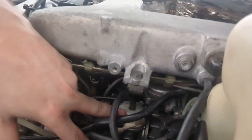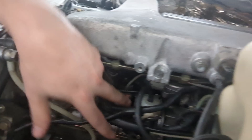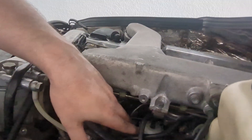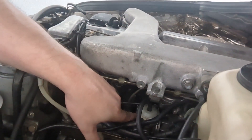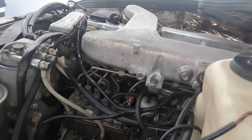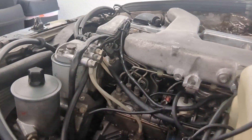There is a diaphragm in here, so I did replace this piece — it doesn't have a problem. What's actually happening is it gets stuck in the down position after you turn the car off. When you turn the car on, it's supposed to release that and then pop up, like when you turn the glow plugs on.